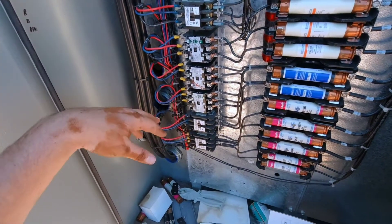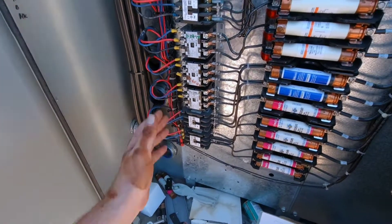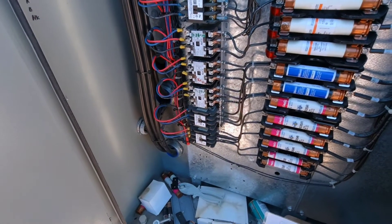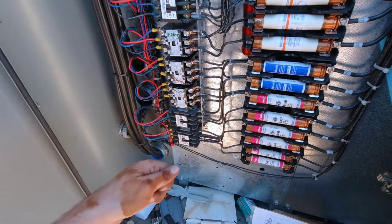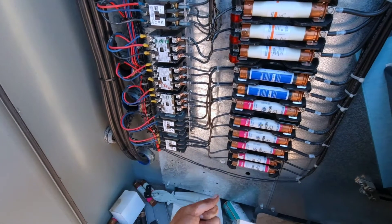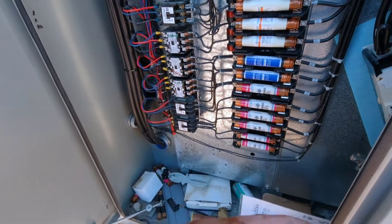This runs two fans. Of the two fans, one of them looked considerably older than the other, so I chose that one first. Sure enough, as soon as I took the cover plate off, you could just see the burn. I pulled the power wires, confirmed a short to ground, and confirmed the ground through the power wires to make sure they were not grounded in the wiring harness — which they weren't.